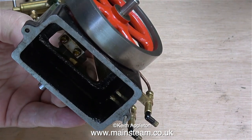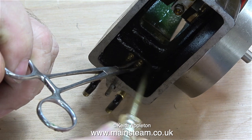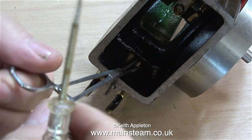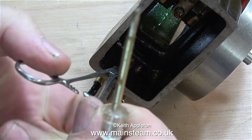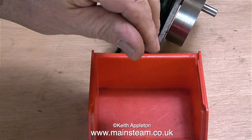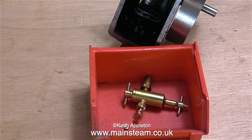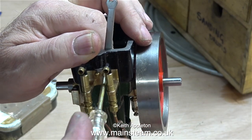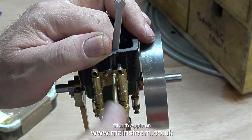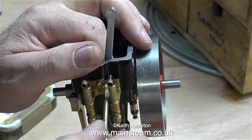Now I need to remove the bracket so I can withdraw the bolt. When I'm first asked to give an estimate for doing a job, I have to be very careful, because some jobs take a lot longer than I would first estimate. You've just seen edited highlights of just removing the engine. Now I have to first of all remove a lock nut from each of the bolts holding the bracket to the engine. To remove the lock nuts, first I used a small spanner, then I spun off the nuts using the point of a screwdriver. Here's my little red box which will contain all the parts I take off the engine so I don't lose them. These are seven BA bolts, so they're quite small, but unfortunately they have been over-tightened.